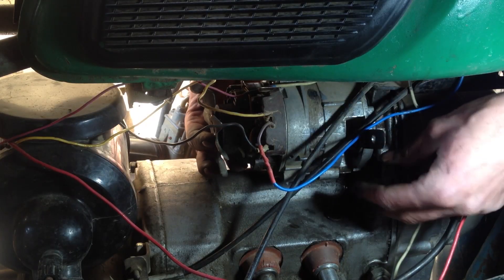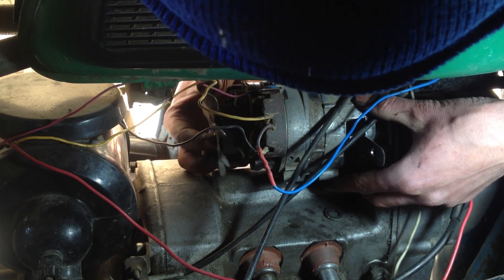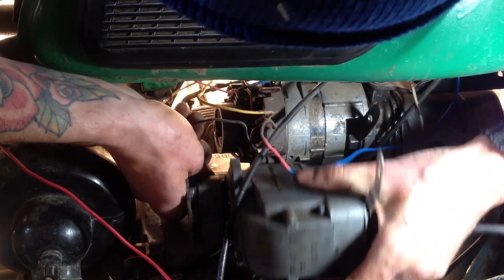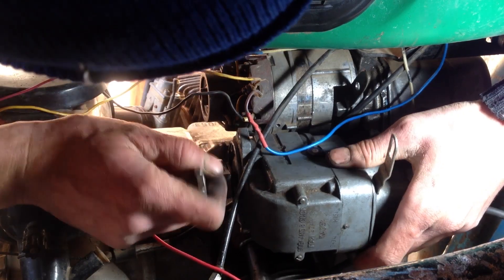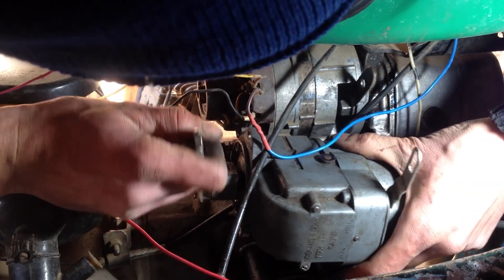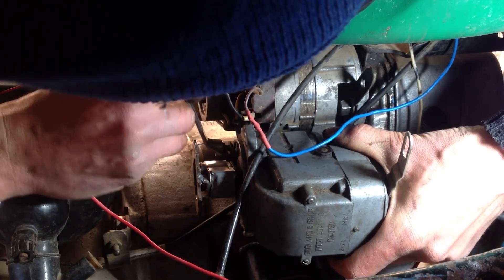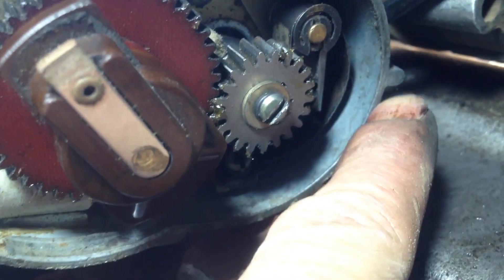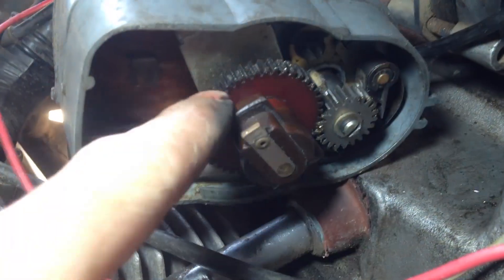For the ignition to work normally, we need to put a small gap between the generator gear and the camshaft gear — hence the generator will scream louder. Of course, if I take off the sidecar and the gas tank it would be much easier, or at least take off the generator itself. But I'm lazy, so I do everything twice as hard as it needs to be. Because that farther-most screw will be hidden behind the block, I won't be able to remove this cover and set the ignition when the magneto is installed in the generator.